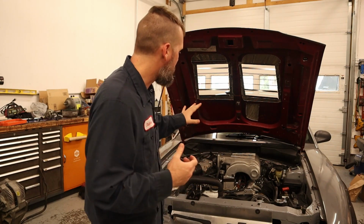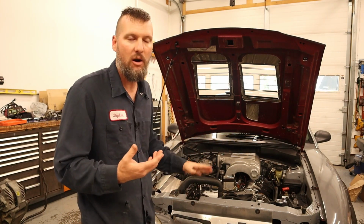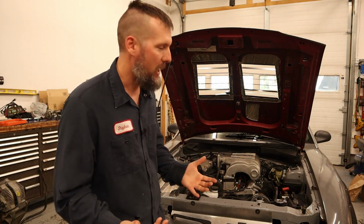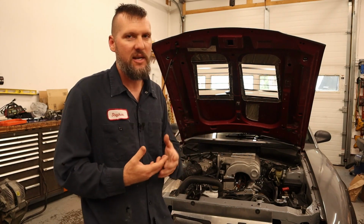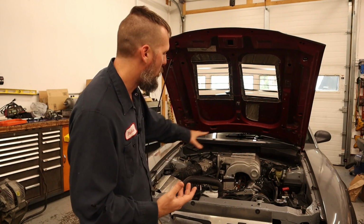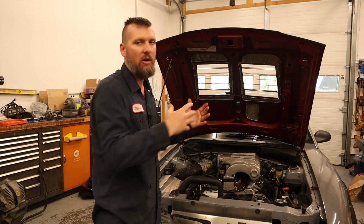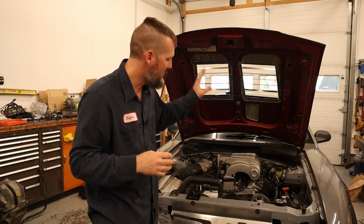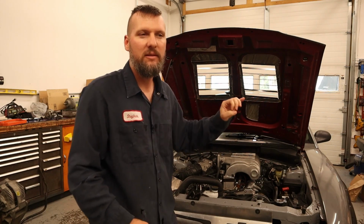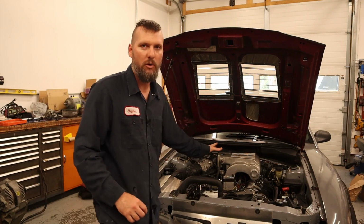The engine harness and fender harness I used for one because I had it. So that was the main reason. There isn't one that I could go steal from any kind of car and not have to modify. All the engine harnesses I would have had to modify. If I used one from like the 4.6, I would have had to maybe modify less on the coil side. I wouldn't have had to add all the coils, obviously, but the mod motor is just so much wider. I would have had all kinds of different lengths, and I would have had to then change all my lengths for the fuel injectors and everything like that. So using the 5-liter engine harness was the least modification in my mind. Everything lined up, I just had to add the coils.